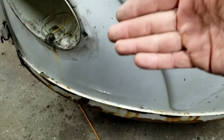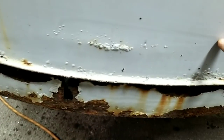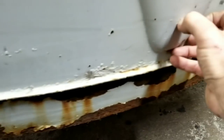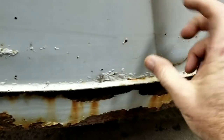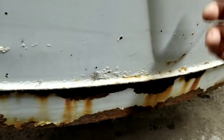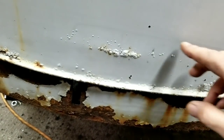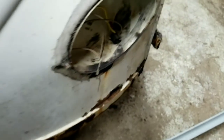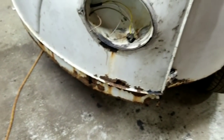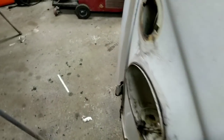What I'm going to do on this piece — of course it's rusted out — I'm going to cut this off. I'll cut this nose; I don't know if this nose is going to come off but the bottom of it will, and I'll make this piece right here. I'll lay another piece over it, drill a hole in it so the water can drain, then replace it. Behind here I'll treat all that area and treat up as far as I can reach to get it to chemically neutralize the rust.